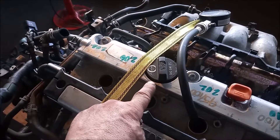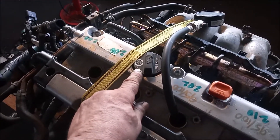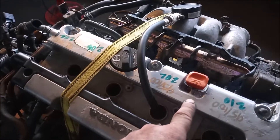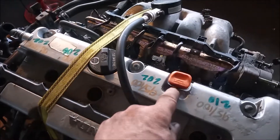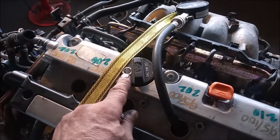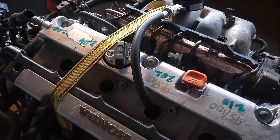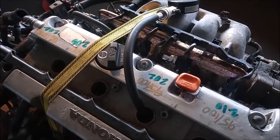One thing to mention is we've made sure that the engine has oil. Engines are usually shipped with all the oil drained out. So before we do the compression test we checked the oil level — in fact this had zero oil in it — and we added a few quarts of oil, because we do not want to even crank with the crankshaft and rod bearings dry.